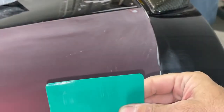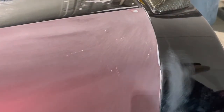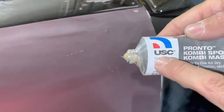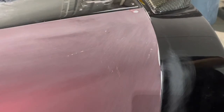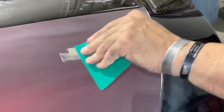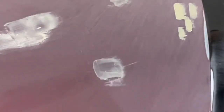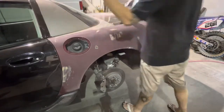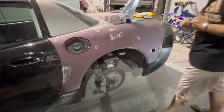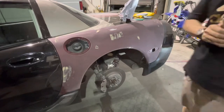Make sure your plastic spreaders' edges aren't all chewed up, or your product won't go on smooth and will make the job that much tougher. This product is made by USC, it's called Pronto, and it's a filler putty — only for small scrapes and chips. Scrape it across and it fills in those scratches. These fenders will go back on, then I'll be bonding the roof, and once the roof is bonded that's when we do the fiberglass work and join this whole puzzle together. Thanks for tuning in — smash that like button, subscribe to the channel, and we'll get part five out next week.